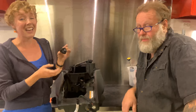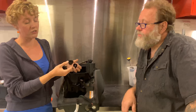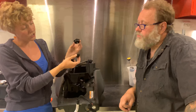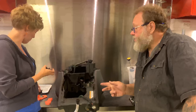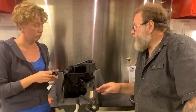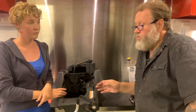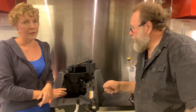No way. Yeah. So that is the idea: when this brass ball inside is straight up or when the bike is running, so it's rattling, it is touching this so the air can go through. But once it's parked on the side stand, the ball will not touch this anymore and the valve will be closed. This valve came with the fuel frame on the XB model. This is not new. No, and then it was taken over to the 1125, and that way it also made it to the 1190. It's a very, very proven technology.